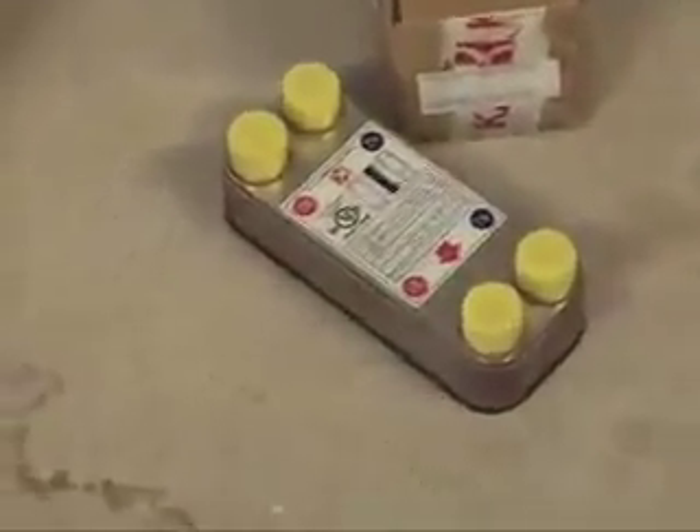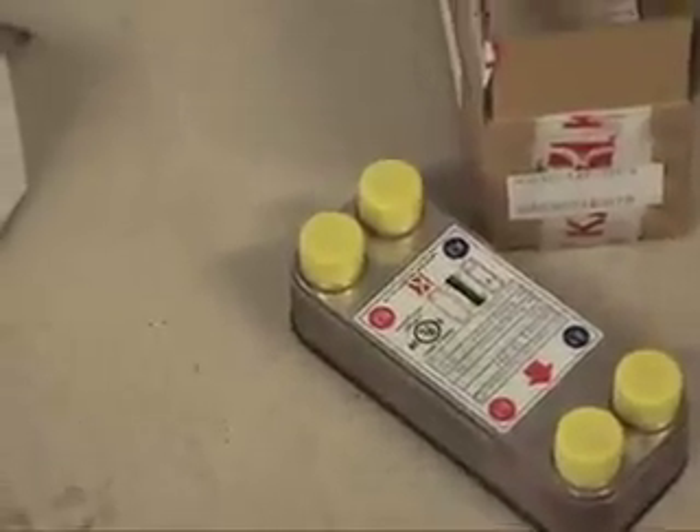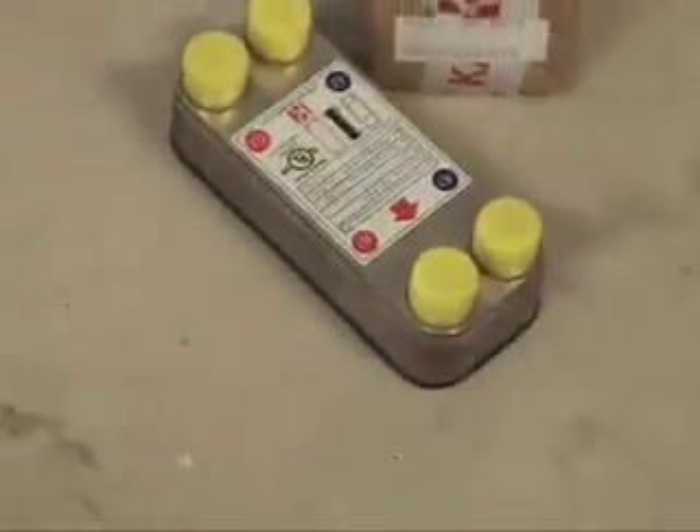This is an additional heat exchanger, just because I don't like having the heat exchanger all the way in the trunk. That way the Vormax will act like a filtering agent and a preheater, because this heater is going to be in the engine compartment very close to the point of injection. I'm also going to add three hydroforce valves, which will allow me to have a loop and also be able to purge the oil from the system back to the vegetable oil tank, rather than dumping it into my diesel as it does now.